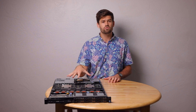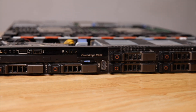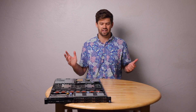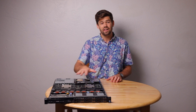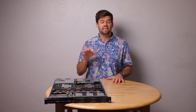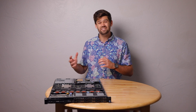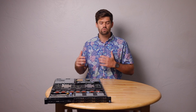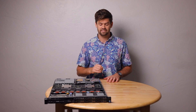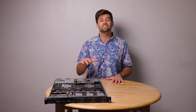Right now I use this as a TrueNAS video editing server. I keep this insanely fast with all SSD storage up front — it's actually got seven terabytes of storage in a RAID Z1 array, all with pretty cheap consumer SSDs. It's got 128 gigs of RAM. With TrueNAS and ZFS specifically, more RAM will almost always equal more performance, because it has an incredibly efficient caching algorithm, and ZFS requires a lot of metadata lookups that really need to be done in RAM. I have a ton of RAM in here, so I have zero performance issues — it's insanely fast.